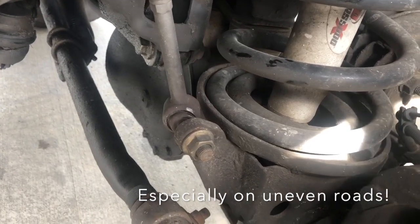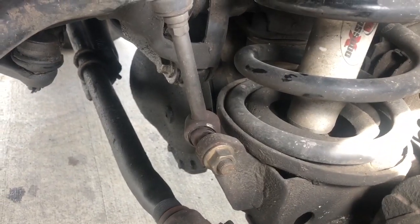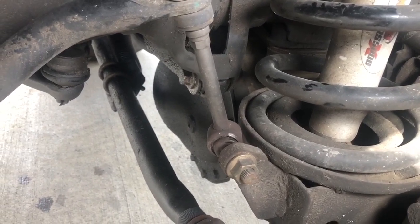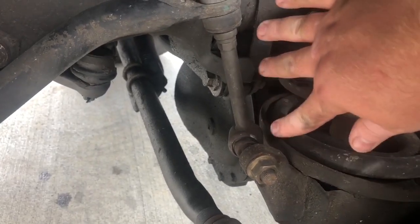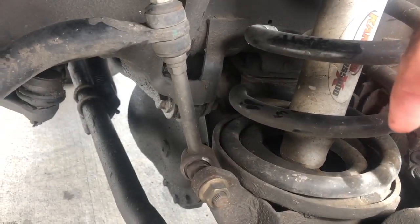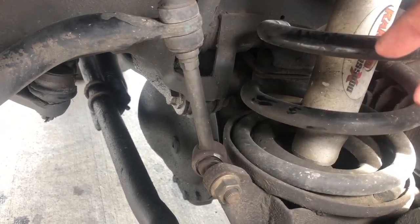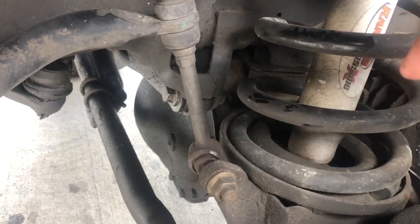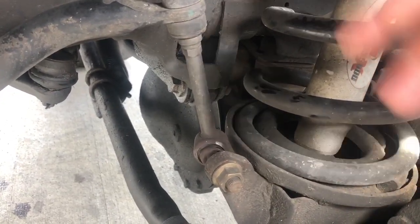As you can see at the bottom side, it's actually at an angle — it's not lined up correctly how it should be. That's another symptom as well. When the wheel is straightened up and I turn my wheel to the left, I hear a popping noise. When I straighten back up again, if you get underneath the vehicle, you can actually move this whole assembly and shake it back and forth, and you can literally hear the knocking sound inside where it's loose — it's coming apart. This is the Moog sway bar link, and I am not a fan. I was a fan of the price — I think this was like 20 or 30 bucks online — but I'm not thrilled with it. I've been let down again by Moog, so here we are replacing it with something different.